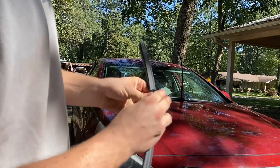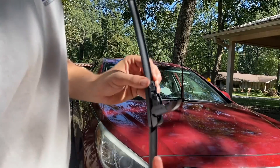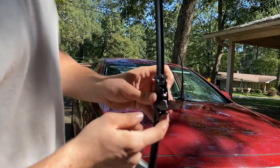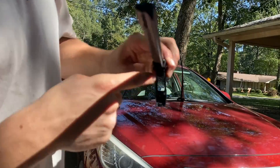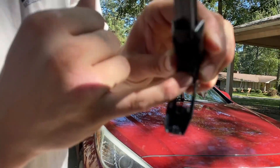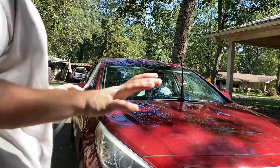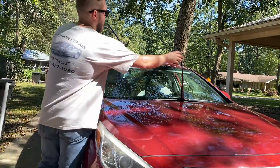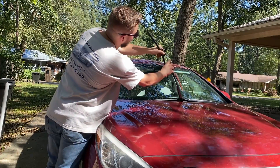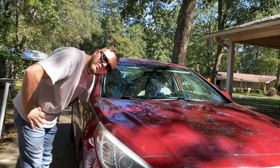Here's what you're going to do with J-hooks: close it right here and pop up the two little squeezy clips. Slide the hook in through the hole, pop this section open — the hook is going to go over the little rod on the inside of it. Slide it through the hole, slide it over the clip, and pull it up until it snaps. Set that down. Wipers done.